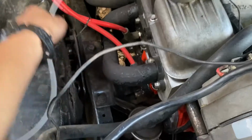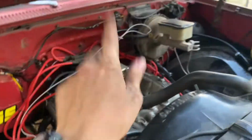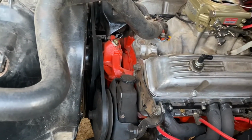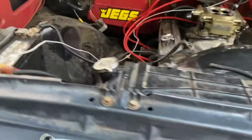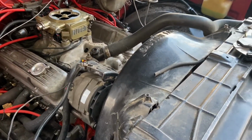Just for kicks, we're hooking up a wire directly from the battery to the white wire over there to see if that was our issue. I had it just plugged into the battery terminal on the distributor, so it's always powered right now somehow, potentially. We'll see real quick. No, so I need to reset that real quick so I can prime the fuel system. I guess it'd be best to do it right here. There we go. Oh, I just saw a bunch of fuel come out of there, so it isn't a fueling issue. And this will tell us if it will at least try to start now.